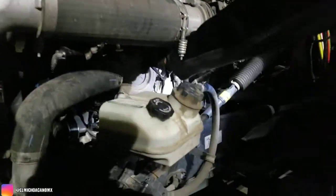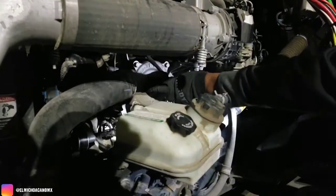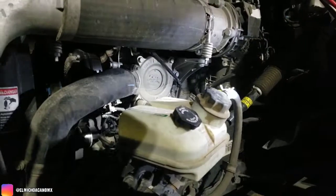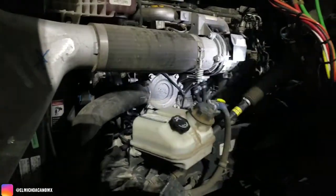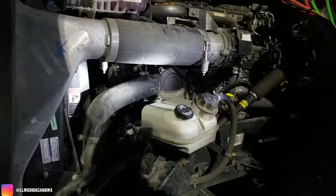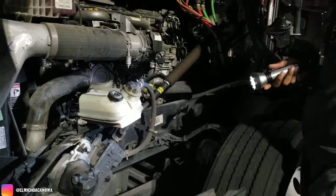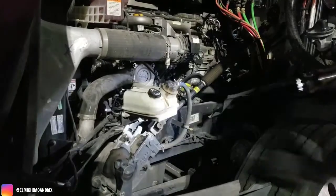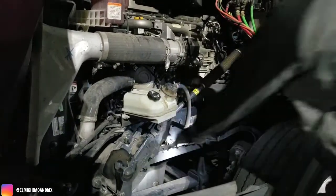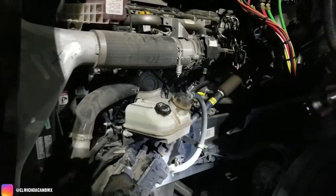We're gonna check the belt-driven water pump: properly secured, not cracked, not broken. The belt in the back — not cut, free play for the belt is half to three-quarters of an inch. Then check power steering fluid level: properly secured, no cracks, not broken, not leaking, per manufacturer specification. We're gonna check the steering box hoses: properly secured, no abrasion, no cuts, both ends secured, not leaking.